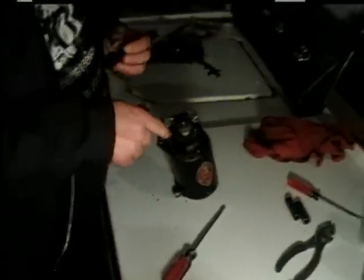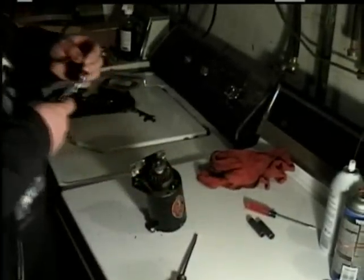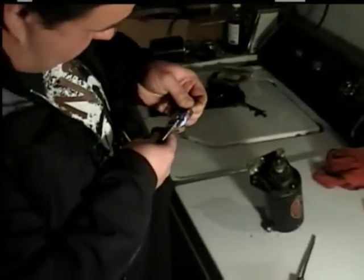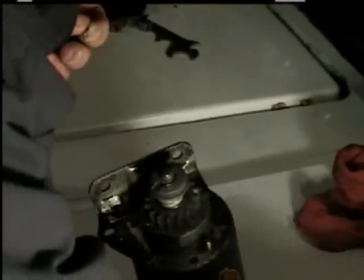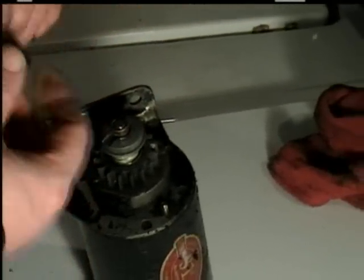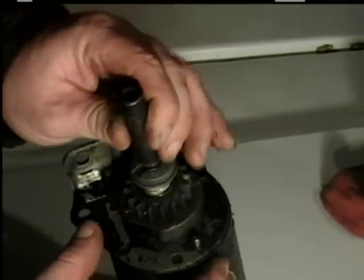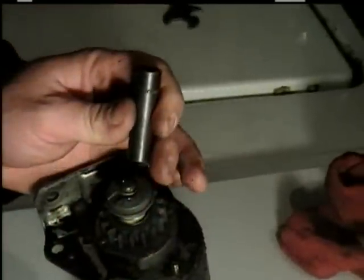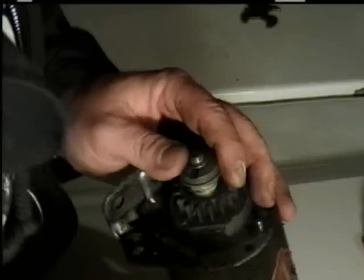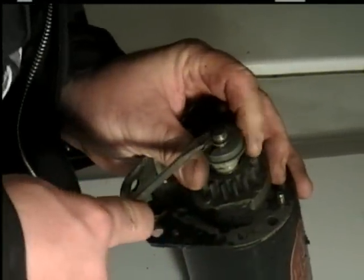There it is off. Then you can go through all the other maintenance steps I demonstrated — clean and lube it, replace the starter drive gear, then squeeze the ring back in a little bit. To reinstall without the proper tool, take a socket — just a regular socket — put it over it, line it back up, and beat it back on. I'm using a 10mm here; a 3/8th might also work. You may have to take the screwdriver and make sure it caught under there good.